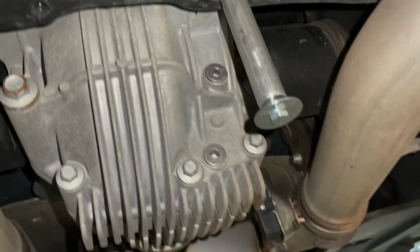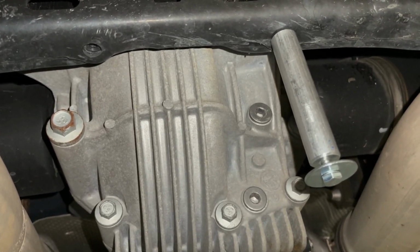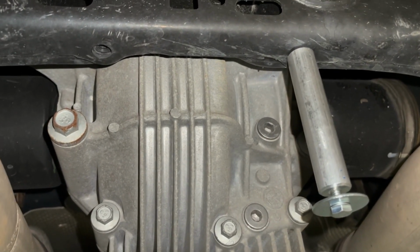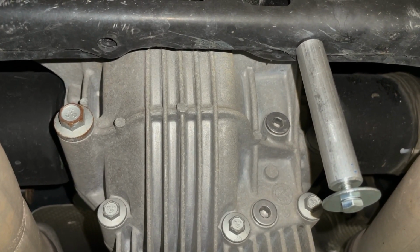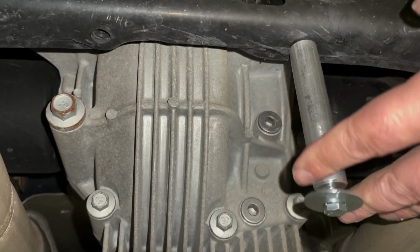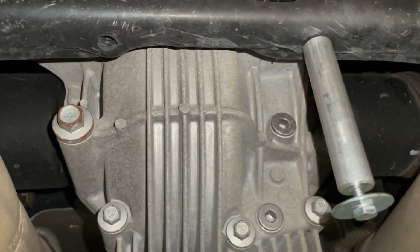Guys, we've got two holes here. One is here and one was over here. Now they say that you can either have threaded or unthreaded holes there. Luckily mine are threaded, so I bought both types of studs for the rear support for the diffuser. All I have to do is screw them in, and then you back off this, because this is actually where the diffuser goes. So tighten it all the way down, take this off, and then we'll have the rear mount for our diffuser.